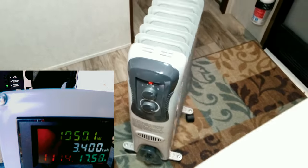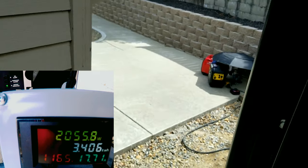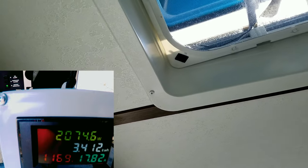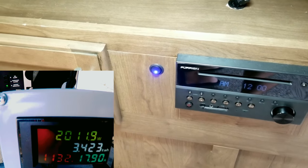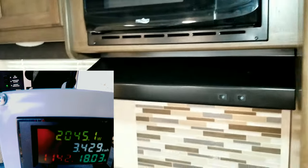Turning the 1,500-watt heater to max — that's 1,500 watts plus 350 watts in the back plus a couple hundred watts on the refrigerator. We're over 2,000 watts, exceeding our rated load and rated amps, but the voltage still looks good. As long as voltage doesn't drop too low, that's what we're worried about — severe voltage drop. Looking at the load right now, you don't even see the overload light flickering yet. There's also a switch I installed on the stereo to save a half amp overnight when dry camping, since that power adds up when it's cloudy.